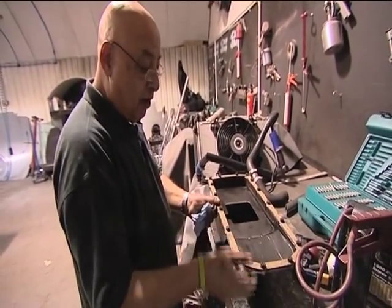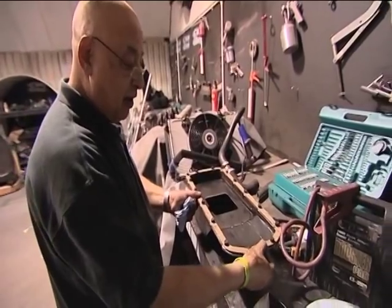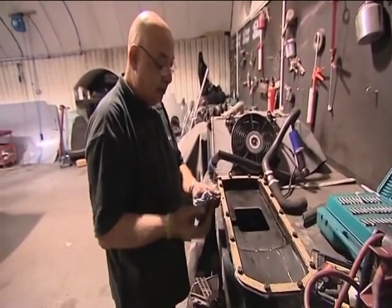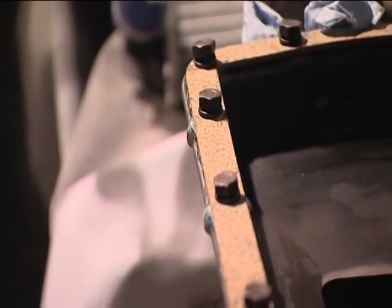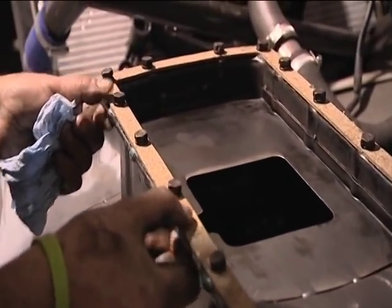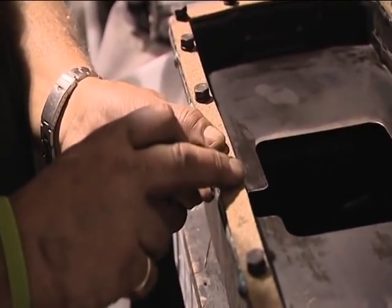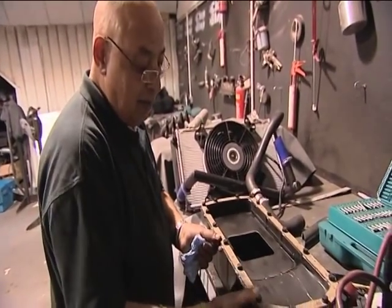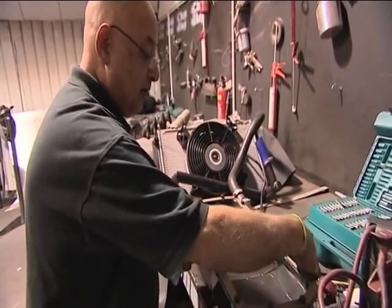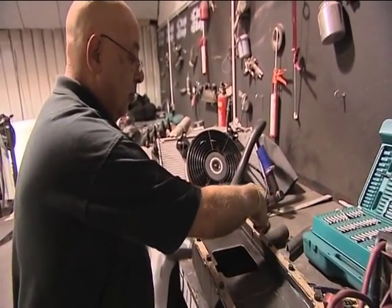An old, old technique I do: put a very light smear of silicone sealer on it once everything has been cleaned. Then, to ensure the bolt holes keep the same size, put the bolts in reverse — it just keeps it level in the bolt holes. Takes a second to do and saves you the aggravation of leakage. If the gasket shrinks or comes out of position, putting the bolts in reverse into all the holes keeps the holes and the gasket in shape while it lightly bonds.